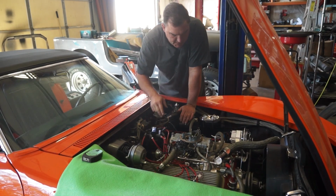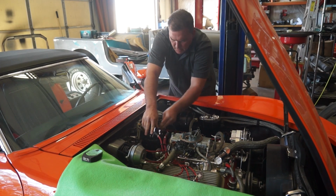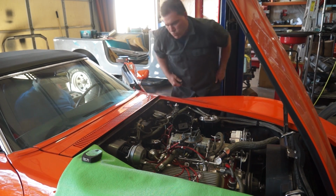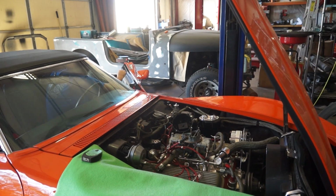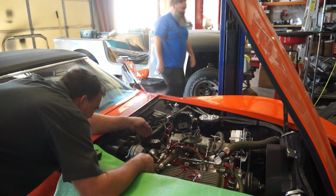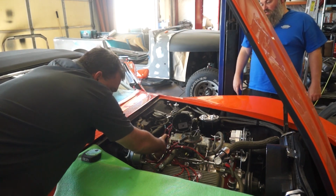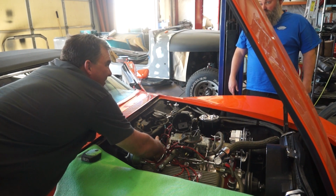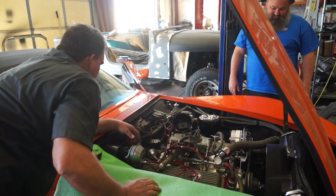Bump our distributor back a skosh. Thank you. That's it? That's it. At least for the moment. It's barely worth the sit-up. It's all right. In like 5 minutes, I'm probably gonna have to bump it one more tooth. Oh, you're a tooth off? I think I'm 2 teeth off, but I'm gonna go 1 tooth at a time. Don't overcorrect. Just because I'm conservative like that, I guess.